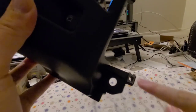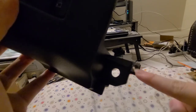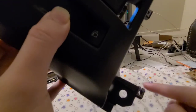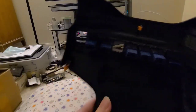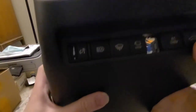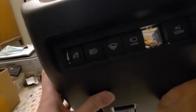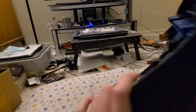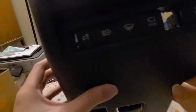To remove the trim panel itself, there are screws — one, two in here — and I believe this one is a 10-millimeter bolt, so you just need to remove that and those two screws. The rest are just tabs, and you basically just pull them out forward. I'll show you step-by-step how to remove it and put it back together.